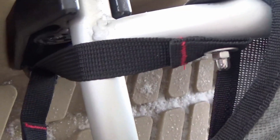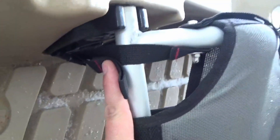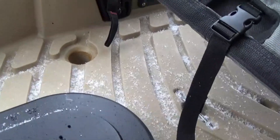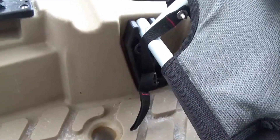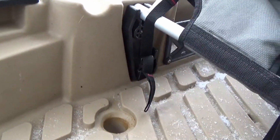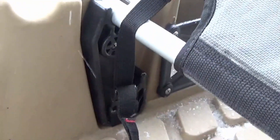Then you'll see here the strap will attach — you're going to take that strap off the seat back itself and bolt it into the actual seat frame, so that replacement bolt replaces the existing bolt. This is a better shot of it. It's really quick and easy to do; it doesn't take a whole lot of effort, just a Phillips screwdriver and a wrench. Make sure those straps are facing toward the center of the hull so you can simply pull those straps tight.